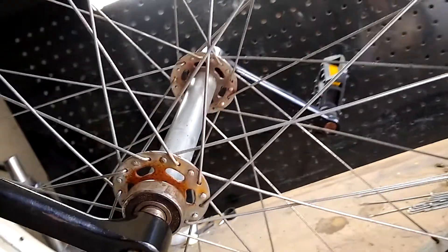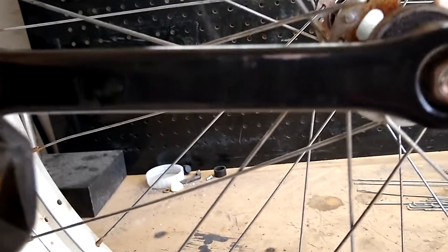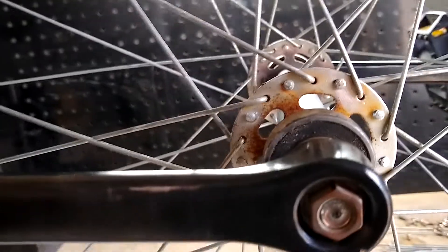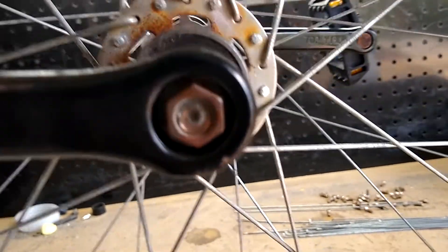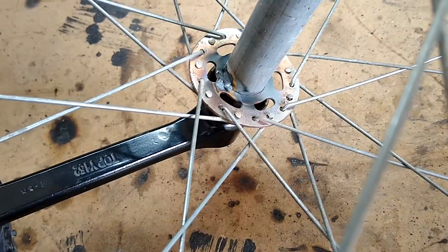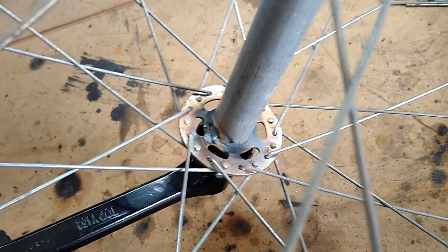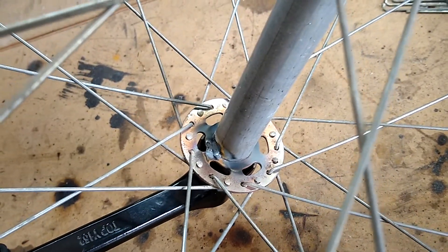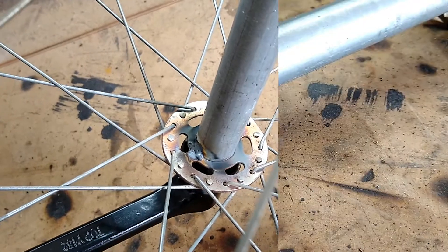The pedals are 180 degrees as close as I could tell. I'm not quite sure exactly how to measure that more precisely because the shaft is tapered - I can't just put a bubble level on one side and then the other. I'll probably think about that before I go ahead and tack weld the hub together. I have some tacks on here, but trying to weld around these spokes isn't going to work out - I'm going to have to unlace this entire wheel and finish the welding so I can get this done properly.